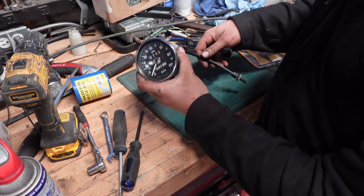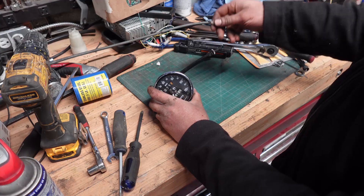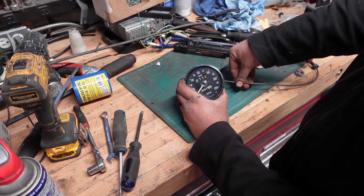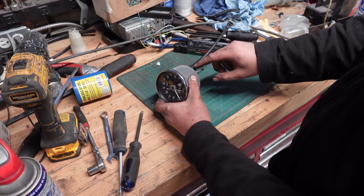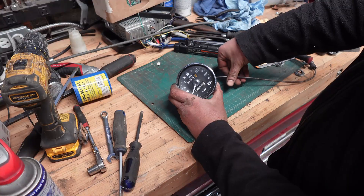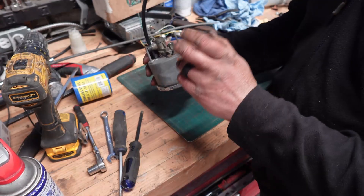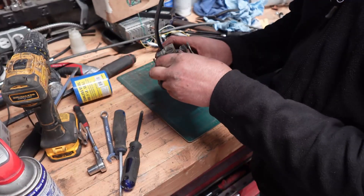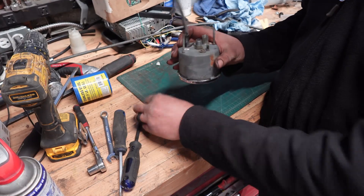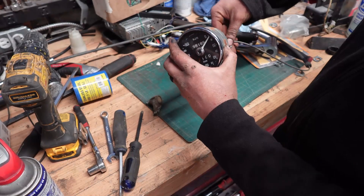We're on the bench with the speedometer. With my spare cable, if I stick that in you can see it does work, so that's all fine. But this angle drive is very sticky — trying to turn it, it's really fighting me, and this is about as fast as I can turn it. So the good news is the speedometer is probably in good shape, but what's probably happened is this angle drive is gummy. I'm going to take it off — and plugging directly into the back, it moves a lot better. Yeah, much better.